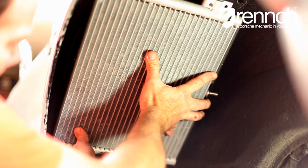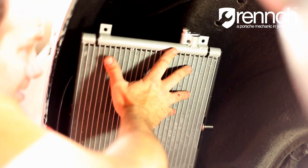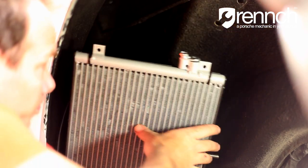All right, first things first, I've got to figure out how to fit this condenser and fan in my rear wheel arch. This is obviously the wheel arch. It's really hard to shoot this, by the way, so I apologize if it's weird or blurry. It's my first time. My original thought was that I was going to mount this kind of like that. The one thing about this condenser and fan is it can be mounted in any orientation you want. So I was going to do this, and I was going to move it up. But the problem is I don't know if you guys can see this in the video, but I've got to mount my roll cage. These are the bolts to mount the back side of the plate to mount my roll cage. So I can't really do it there.